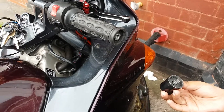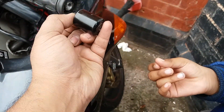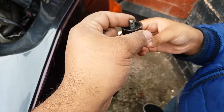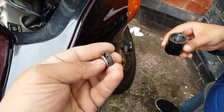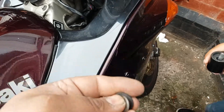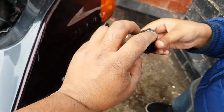To fix the dodgy sticky throttle — the problem is it goes too far in and compresses against the rubber. The trick is to use some washers to give some space. Set these washers up: that one first, then the big one, then the flat one.